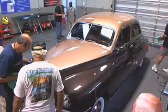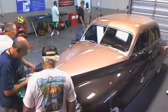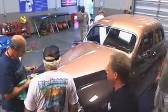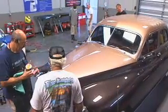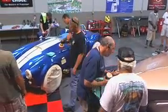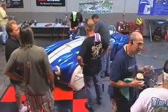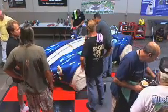Nice to meet you. Okay, well, here's where we're at. We've already machine polished this car twice. Now they're finishing up the machine polish on the Cobra over here, and then we're going to machine apply some waxes. We're going to use a Blackfire over here and a Pinnacle, both paste waxes, but we're going to apply them by machine. That's what we did on Lou's 47 first series.